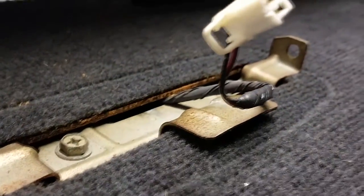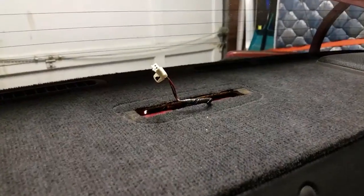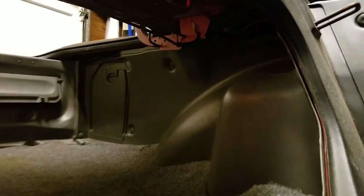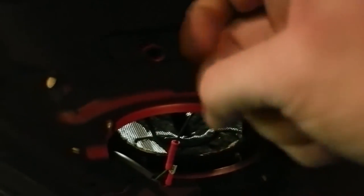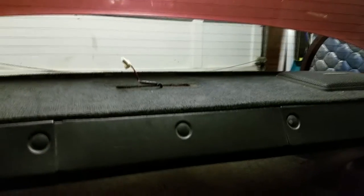Once the third brake light assembly has been pulled and you have pulled this little plug, undo the two bolts holding this bracket on. With that bracket removed, we can finally pull off the carpeted rear deck. To do that, come underneath and inside of the trunk of the car. It is a bit of a tight fit, but you can get access to things under here. These little tabs run all down the length of the trunk on the underside of the metal rear deck. Pop each of these little tabs through the metal deck, and once you've pushed those tabs through, you will be able to lift the carpeted rear deck and bend it just a little bit in the middle so that you can rotate it and get it out of the car.